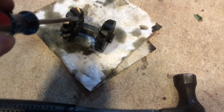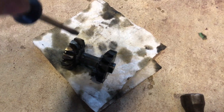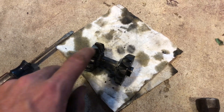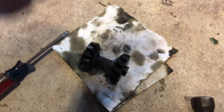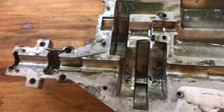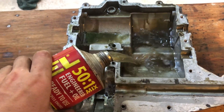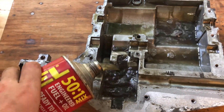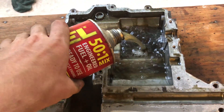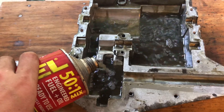After it's finally cooled down, I'm going through and picking all the slag off - it's very tedious. Sometimes the slag is really hard; you can put your screwdriver in there and whack it with a hammer and 9 times out of 10 it'll come off. Since the entire case is full of slag and crap, I'm going to pour some old fuel in there and agitate it with a paintbrush to clean it out.